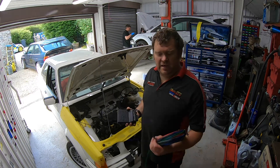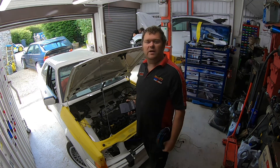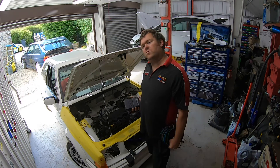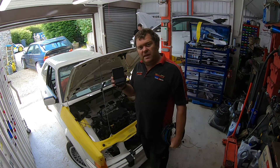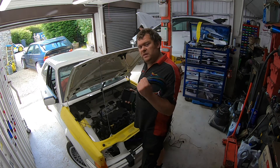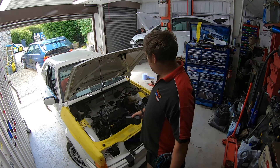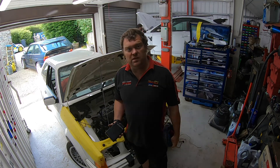So let's get this in there. This is the flying loom that we supply with the ECU — we'll be building our loom from this. We'll get this mounted, get the bits and pieces through the fuse block, through the grommet, and then start working our way around the wiring loom into the engine bay. Hopefully a nice straightforward job.